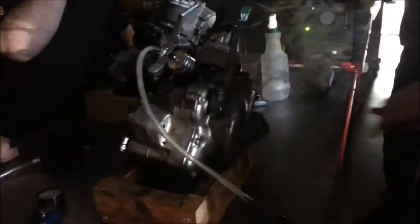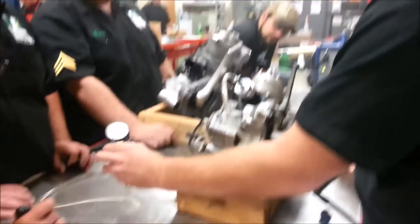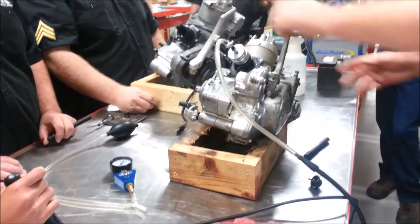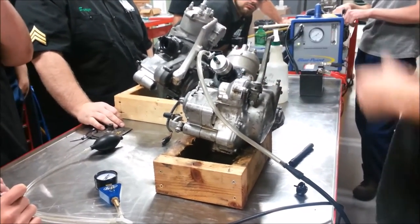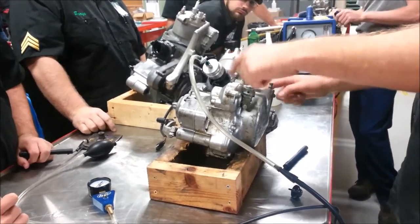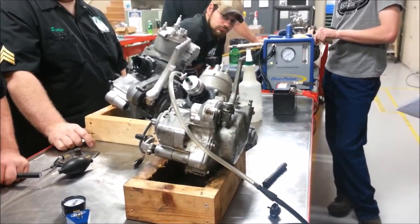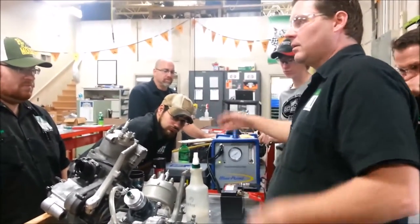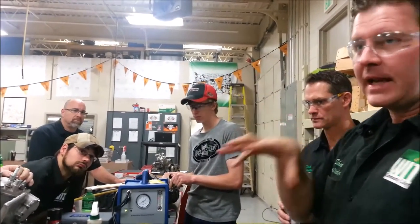At the beginning of this, we said we were going to talk about what the bare minimum is that shops are going to have — they'll have this two-stroke tester. How effective really was this tool? Not very. So we cheated — we used the adapters and applied a controlled PSI, not more than 10, and we could see the leak with the bubbling. You can hear it too. So that would have been something I wouldn't have noticed until after I took apart the engine. If you're doing a lot of two-stroke motors or ATVs where you want to test differentials or gear cases, this tool makes sense.